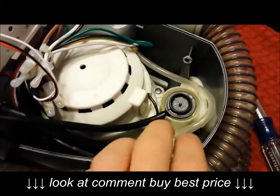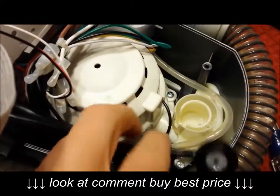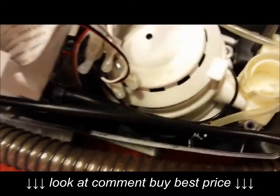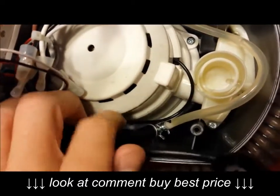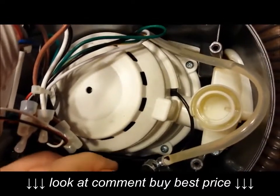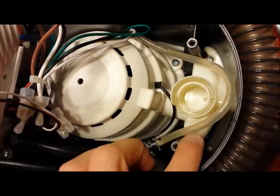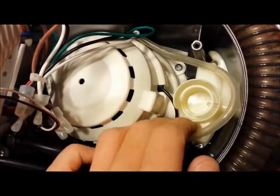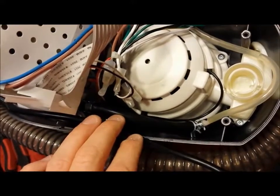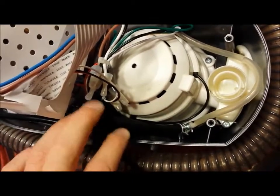Underneath here we'll get to the pump. This little piece I mentioned for checking blockages is the bottom of the reservoir tank — it just comes out. The black tube comes up through the pump and back out, then splits two ways: one black hose goes to the cleaning chamber, and you can visually inspect the clear hose for blockages. If you're getting nothing out of both outputs, the problem is before the Y-connector.